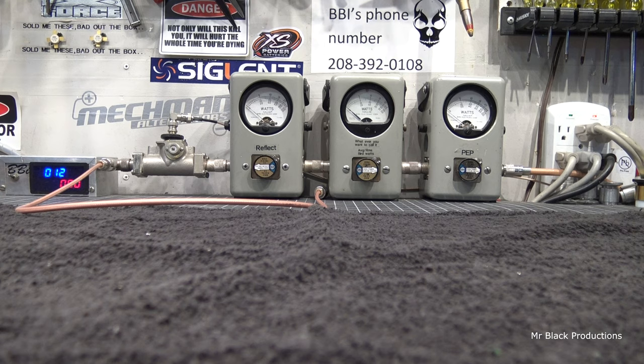It's like I said, you might want to think about turning your head unit off when you're talking on the radio. And he says, well, it doesn't matter, I'm coming through the speakers with the head unit off. And I went, oh shit. Well, that's definitely a proximity issue then. And that's how that question gets answered.